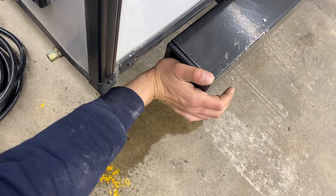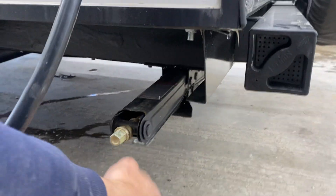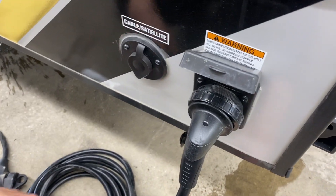That cap just presses back into place. Right around the corner, right underneath, you've got your stabilizer jack. What that's going to do is run down, contact the ground, give it another turn or so just to firm it up, and that'll get rid of any sort of bounce you see in the unit right now. Just keeps things firm while you're out camping.